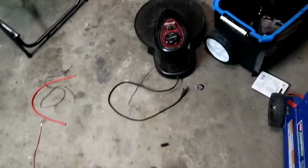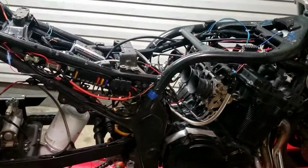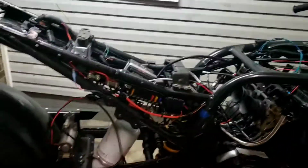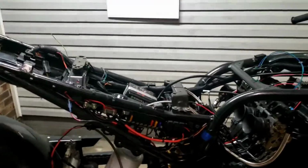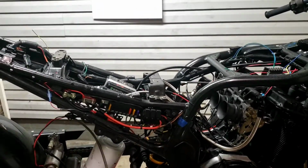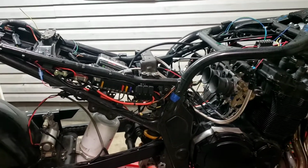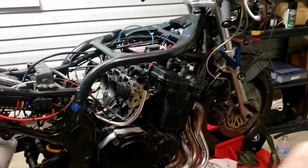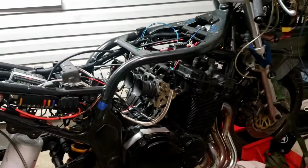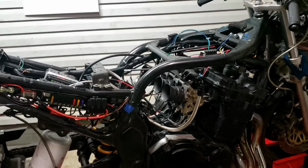And when you turn it on, it sucks gas in. And it builds fuel pressure until it hits the fuel pressure it's supposed to be at. At that point, it starts puking it out over into the tank, and it just sits there. You hit the key, and you hit the starter button. Starts cranking as soon as it detects RPM. Pump's on, fuel pressure spikes, injectors fire. We get our priming pulse, which I think is like a 1.2 millisecond pulse. Just a squirt of gas, basically like an old accelerator pump carb. You're just going as you're cranking. That lets it pop. Once it pops, it takes off on its own and sits there and idles.